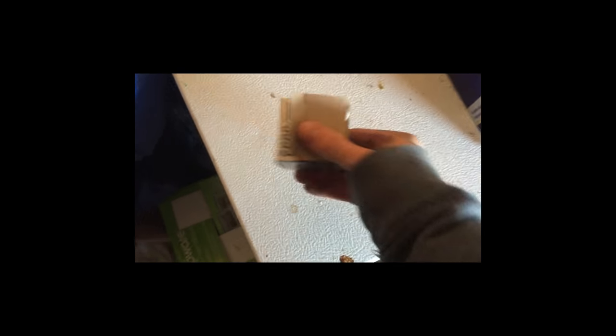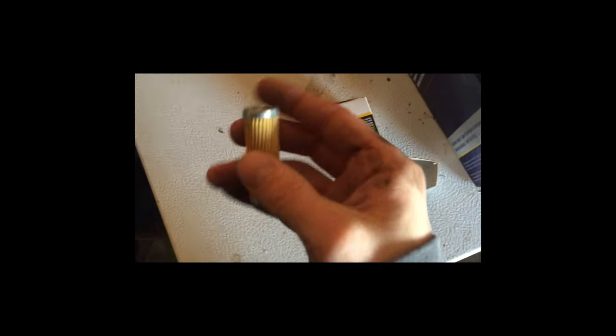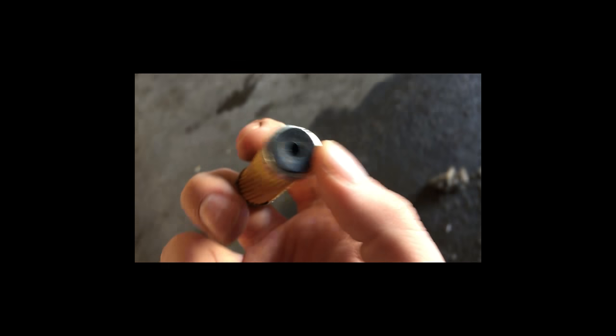Now, I just wanted to show you what the filter looks like on these older carburetor cars. They're little cartridge filters — just this little guy right here. When you're putting this in, you want to make sure that this part right here is facing where the fuel comes into the filter. This part goes to the back of the carburetor.